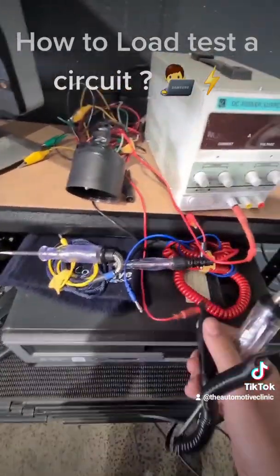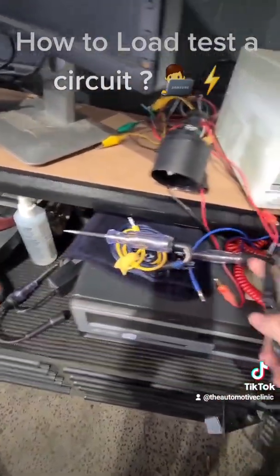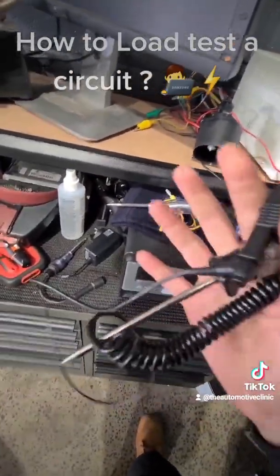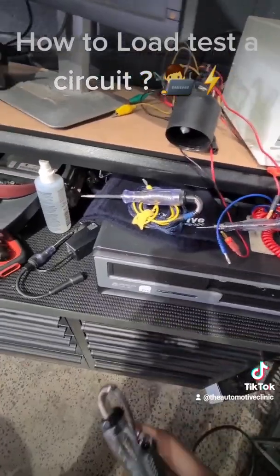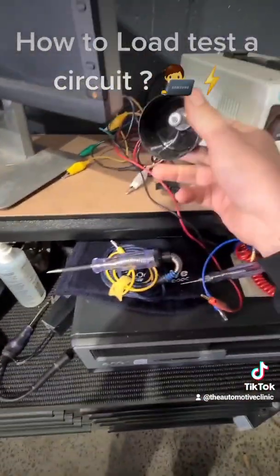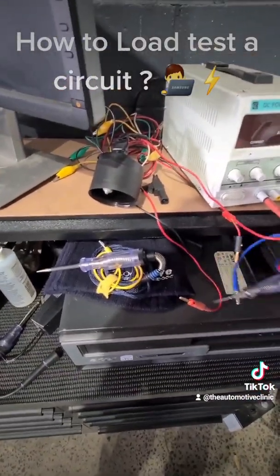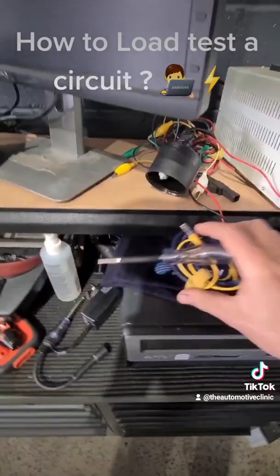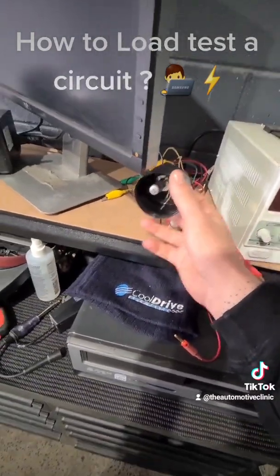So be very careful with LED test lights — they have their place, but you can get in trouble very quickly. Normally I'll use a normal incandescent test light for pretty much everything — it's fantastic because it's small. LED ones do have their place, but I don't get a whole lot of use out of the LED test light; I normally just use an amp clamp or a voltmeter. With your load testing, be very cautious of what you're pulling through a circuit. Don't just stick a headlight globe or a brake light globe into anything, because you will cook computers, BCMs, fuse blocks and all the above — especially now that lighting on a lot of modern cars is BCM controlled.